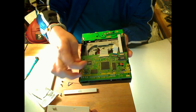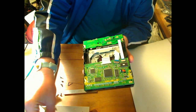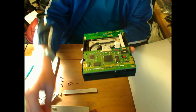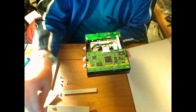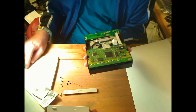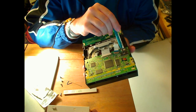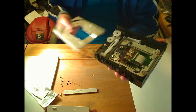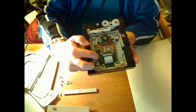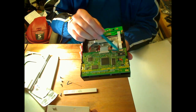Inside you'll usually find little silicone thermal pads that help take heat away into the cover. You usually can't save those. The chip with the metal piece on it is the motor driver — it drives all the different motors: the ejection motor, the motor that moves the head back and forth, and the spindle motor. Usually all three are handled by one chip these days.